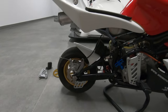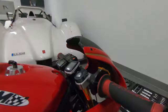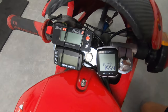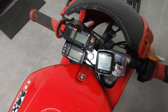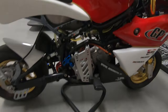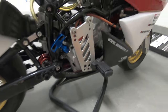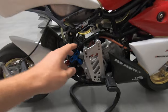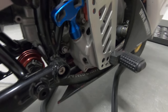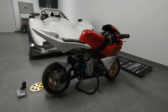I really want to see what it can do for top speed again. I built a bicycle speedometer — it's right here — so you can clearly see how fast you're going, and I adjusted it properly so it shows the right speed. Here you also have an RPM gauge so you can see how much the engine is revving. I had a lot of problems with the air cooling and most problems with the starter — it was plastic so it broke apart every second engine start. I replaced it with metal, made it completely from metal even inside, and now I can just turn it on normally.